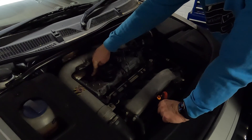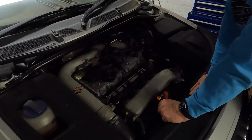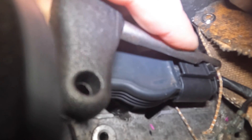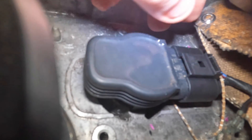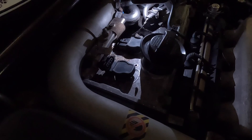In this instance we'll take it that there's a fault on coil pack one, so we're going to disconnect the electrical connector and remove the coil pack. I'm taking my electrical connection tool, putting it over the clip at the back, pushing it back — you hear that click as it pops out — and that allows me to wiggle the plug backwards and disconnect coil pack one. Easy as that.